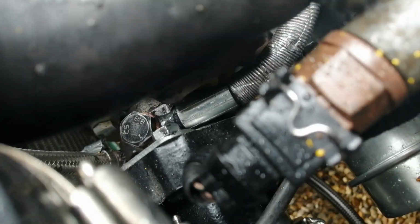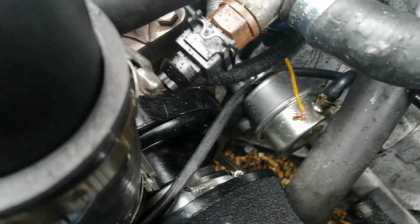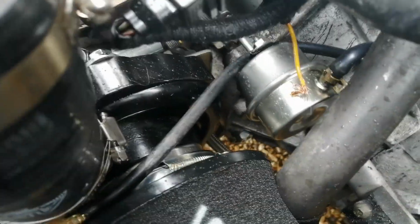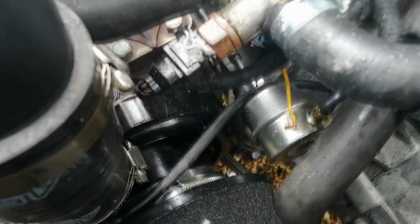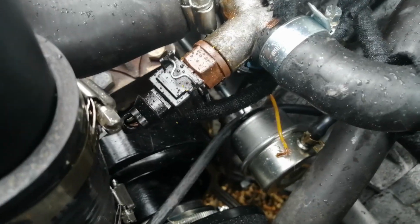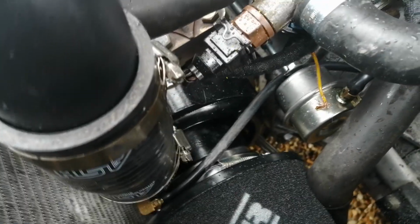Like I said, the only downfall being the oil feed gasket and the wastegate fluctuating without a boost controller, which is nothing major really. Obviously, if you're running the higher power figures, you'll need to run a boost controller anyway, and how often is it really that you're going to be running a GT28 with an internal wastegate without a boost controller? For now, I'm wanting to stay around the 250 to 280 horsepower mark, but in the future we could go 300, 350 and see if the turbo takes it. Worst case scenario, put the turbo to the absolute test, and I honestly think that it'll take the boost and take the abuse, because every time I've drove this car, especially now with the manual boost controller, I've had no issues with it holding boost whatsoever.